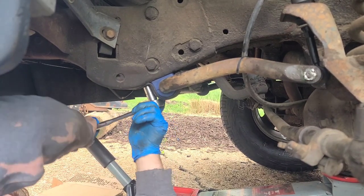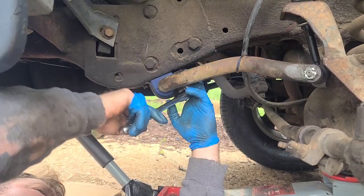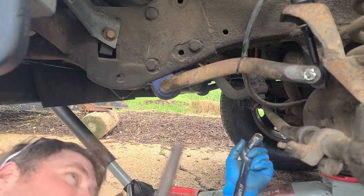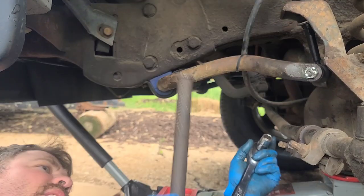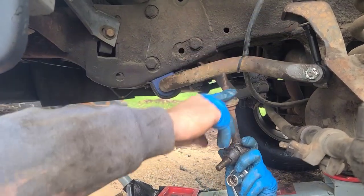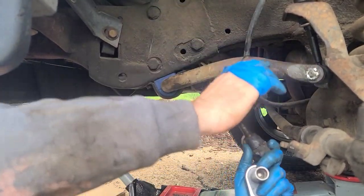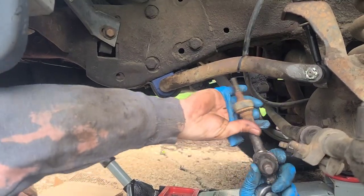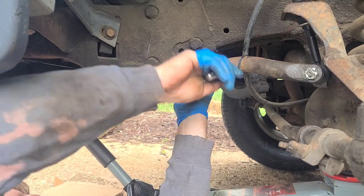Put the tire back. Did you get to drill through it? No, this one, since it's saddled, I beat on it. So I took this fork, like I was showing them, and I beat it as hard as I could down there, so it was giving pressure against the tie rod right here and against there. And then I unscrewed this castle nut just enough that it was out and got up, and I stood up and got as full a swing as I could get without hitting the truck. And finally, it was like doop, doop, doop, and about 4 or 5 of them came off.